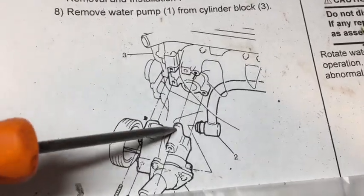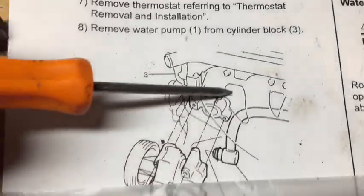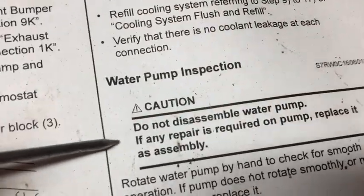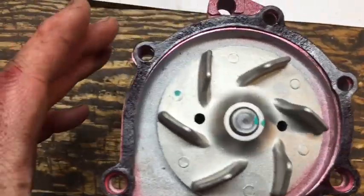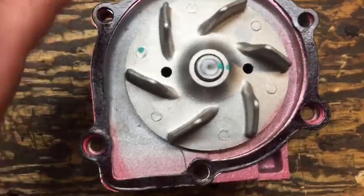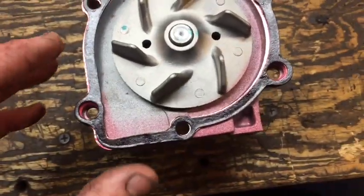As I said, the package does come with an o-ring — that's the o-ring you need right there. It's not shown on the drawing, but when you remove the housing there's an o-ring on the back side of it and the manual tells you to use a new o-ring. That's what it's for in the kit. The manual doesn't detail this because they expect you to change it as an assembly. There's the new o-ring and the old one removed. I've decided to go with the paper gasket that comes with the pump assembly rather than sealant, since the likelihood of getting it in place without disturbing the sealant is slim to none given the struggle involved.